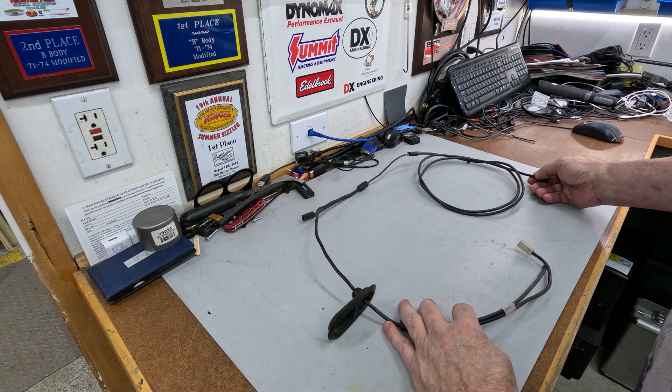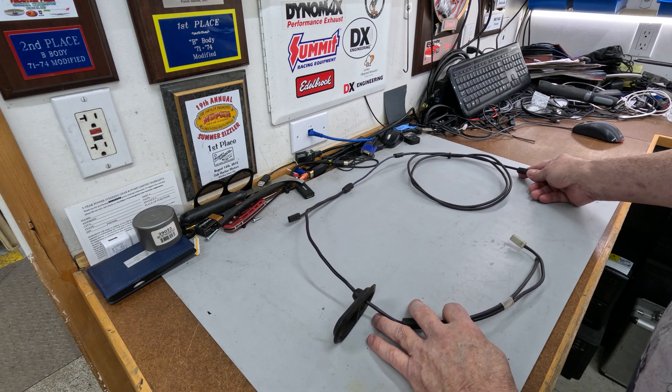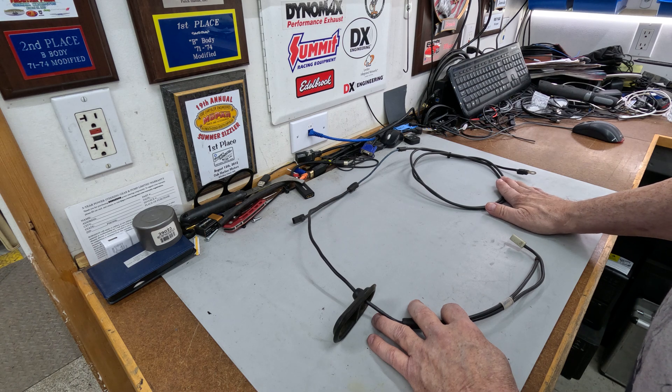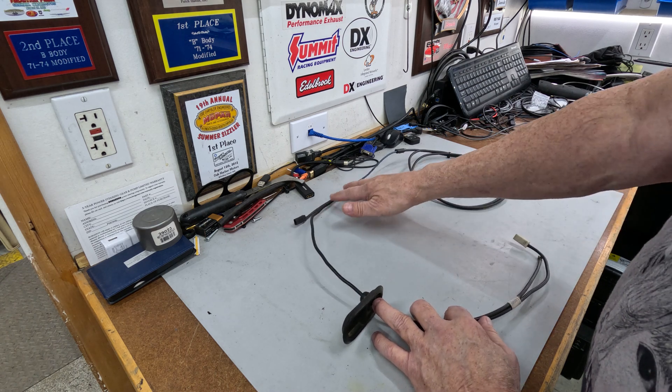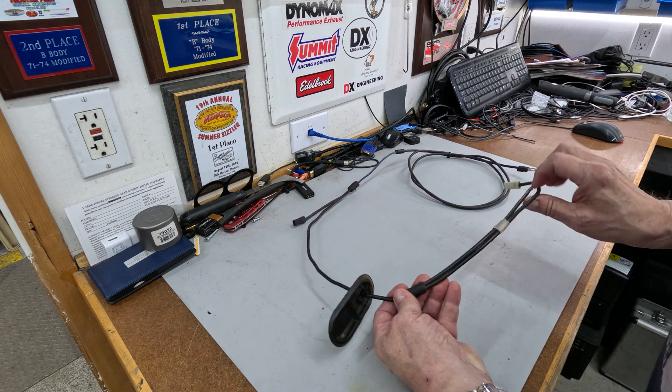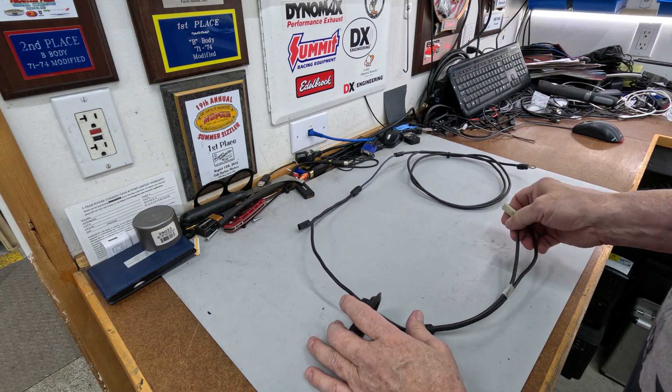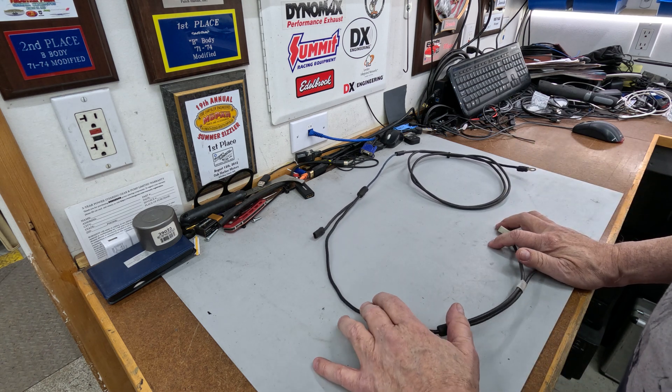Pretty much made up of about an eight-foot section of 10-gauge wire. For this segment, this appears to be 12-gauge. It splits off into two female Packard connections that connect to the fuse panel — I'll show you that in a second over at the fixture.